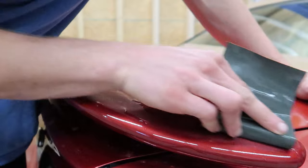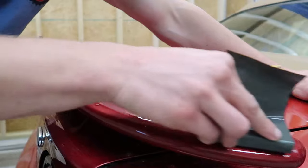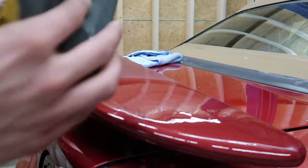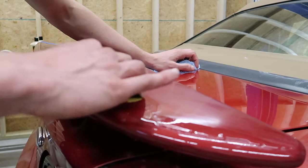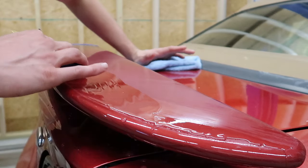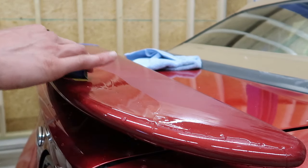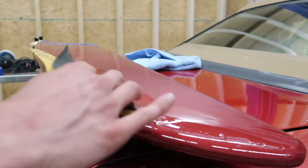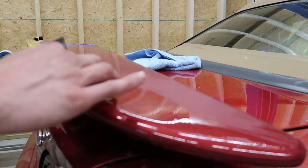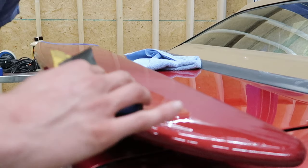Another thing to keep in mind is if the pad is worn out or not, because if it is too worn out, you're gonna just be wasting your time because you're not actually gonna be getting as much sanding done as you could be with a fresh side of the pad. Some people will do 10 seconds of sanding and then switch to a new side of the sandpaper and go through sandpaper like crazy. That's definitely the most efficient way to do things. However, I let it go for a good little bit until I really start noticing that I don't have much power left. I actually like it when the sandpaper dulls down because it takes a little bit more time, but I can do it safer. But obviously, if it's so dull that you're not getting anywhere, you're just wasting your time. So keep an eye on that as well.